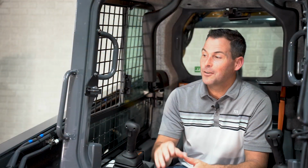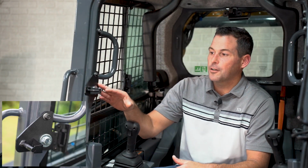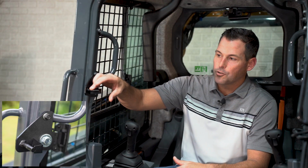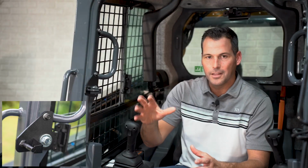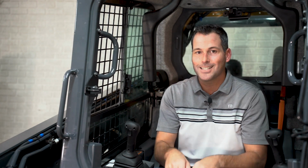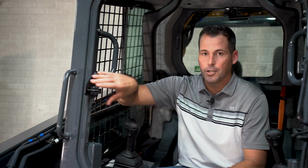All right, to talk about the striker plate and the brackets, let's go into the striker plate first. This is a 3/16 powder coated steel piece. We do have our welded in striker, and then we also have a striker guard so that you don't snag your shirt on it, that kind of stuff. But what we've done is we've incorporated quite a bit of adjustability in this striker so that when you're trying to perfect that seal around your door, you're able to use the adjustability of this striker to accomplish that.